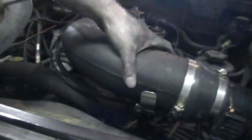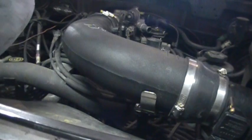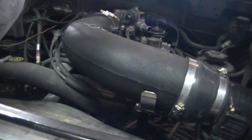Okay, so the next hose clamp is the one that holds the lower coupling onto the pod filter. Now also don't forget to plug in your IAT sensor, which is at the back of the intake tube, and the mass airflow sensor, which is kind of in the bottom right hand corner of the screen. That's very important. I must have cut the part out where I plugged that in, so just don't forget about it. That's the important thing.